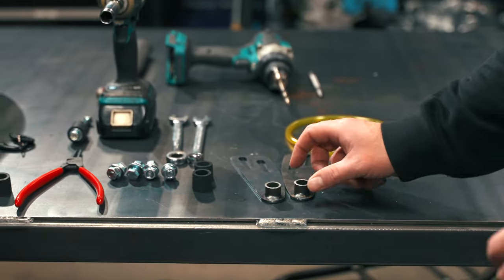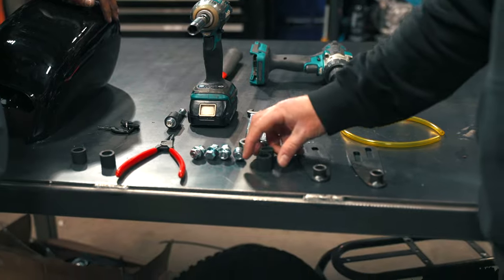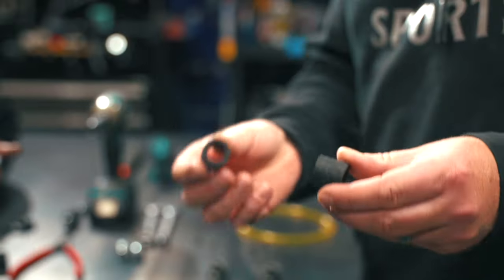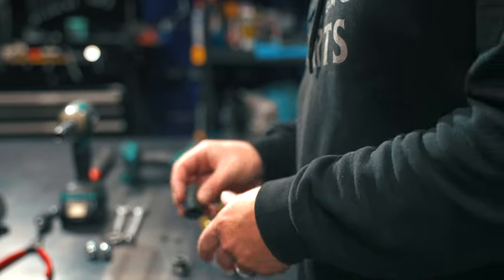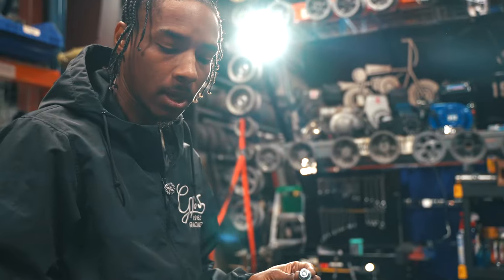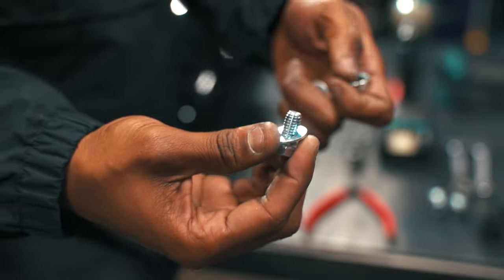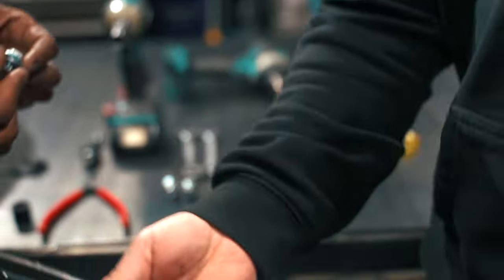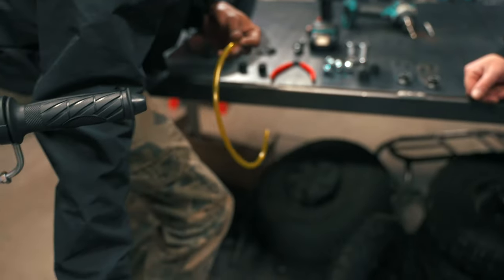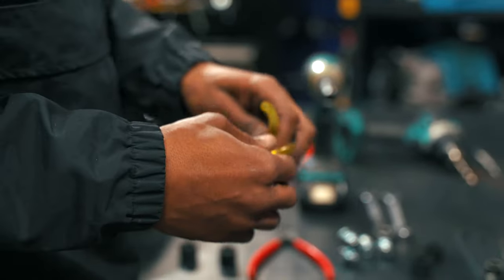So in this kit you get the brackets, which are adjustable — you can move them front and back. You also have the rubber mount bushings. Anytime you mount a metal gas tank, you definitely want to have rubber bushings in between all of the metal. Necessary hardware — it's going to come with 5/16ths coarse thread bolts, and the nuts are serrated so you won't have to torque them; you don't have to get a wrench up in there. Those bolt the bracket onto the frame. And of course, you're going to need additional fuel line because you'll be relocating your gas tank from right on top of the engine to the top of the bike. So it sends you additional fuel line as well.